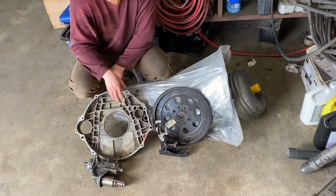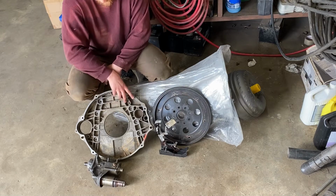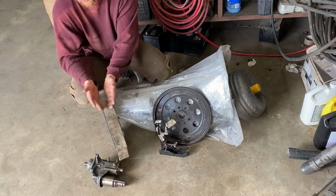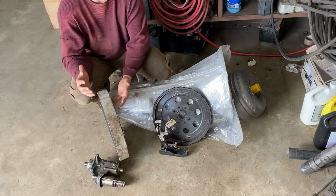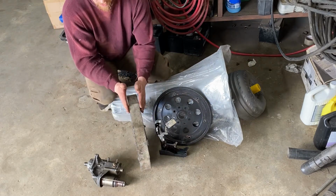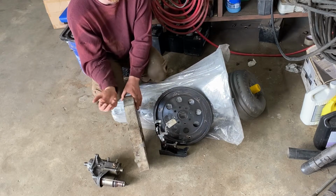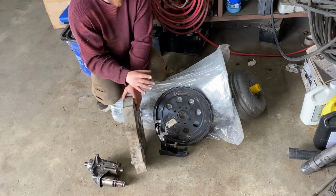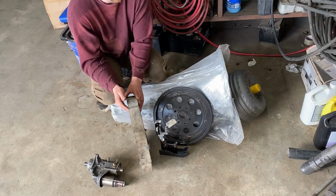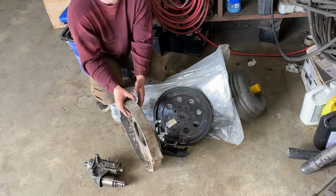In addition to doing all this, you need the second gen Dodge 94 to 02 trans adapter plate, as the first gen Dodge trans plate is 1.2 inches wide, and the lockup converter, because it's a larger converter, uses this second gen adapter, which is 2.4 inches wide. So that will change your drive shaft length. The front drive shaft will need to be lengthened and the back drive shaft will need to be shortened. My hope is that with only the inch and a quarter difference, there'll be enough slip in both drive shafts that we won't have to extend or change them.